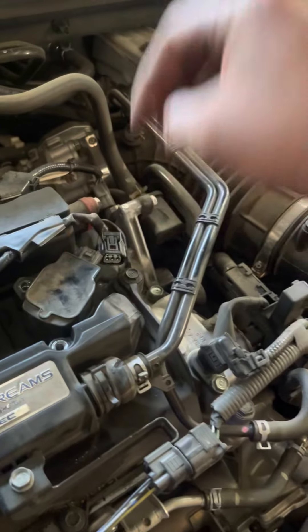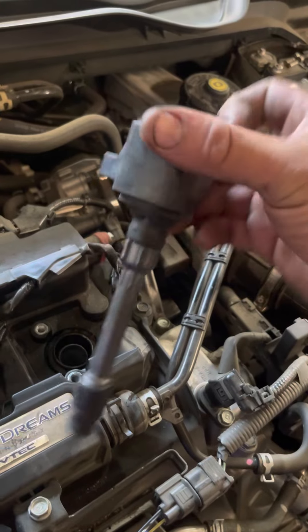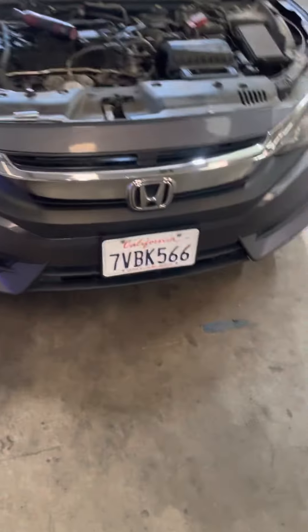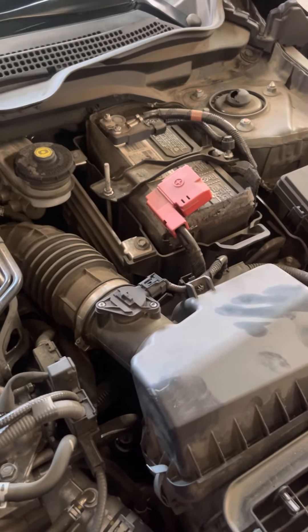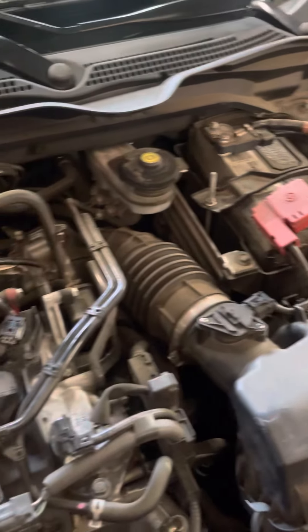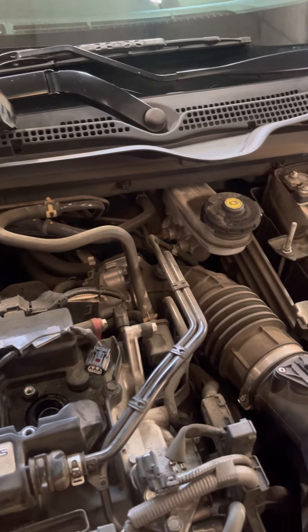You take out the connector — this is the connector — and this is the ignition coil. On this car I changed the ignition coil as well because it was failing. One of the spark plugs was bad too. On the porcelain side — the white pieces on the spark plug — it was really, really burnt, which was a big sign that the spark plugs were done.